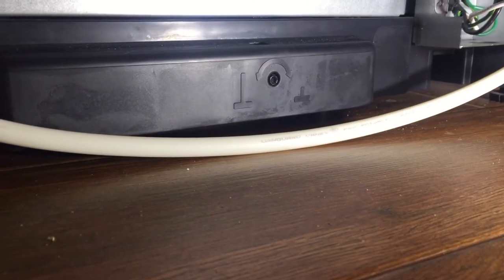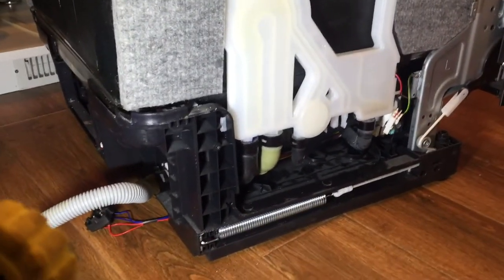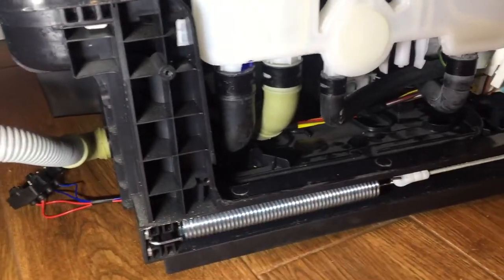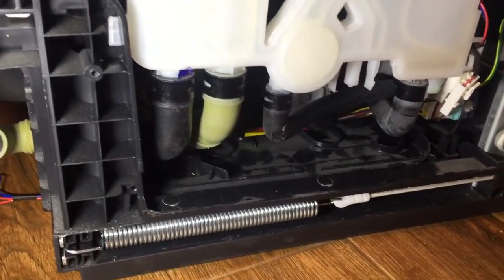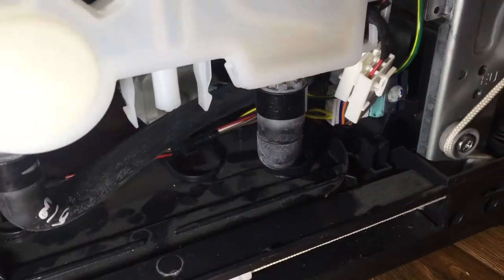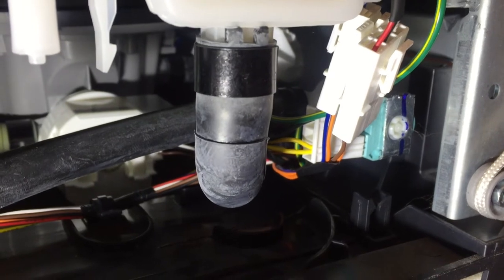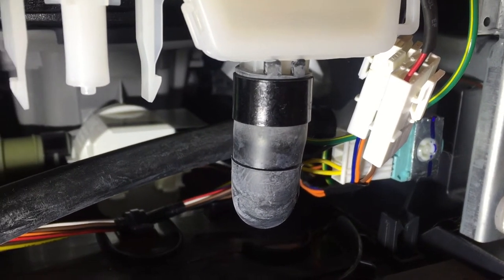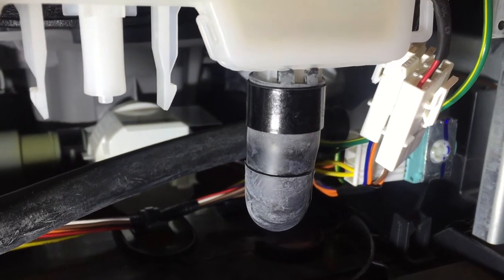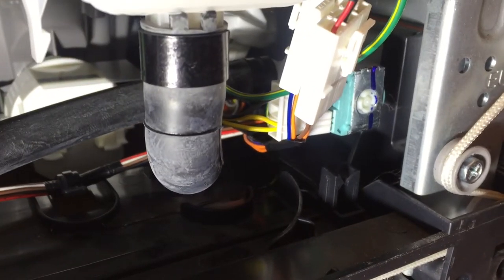That was looking good. I didn't put it on risers this time so I can't see under it, but the puddle is always so big it should be pretty obvious. While I've got it running through a cycle, I decided to take the side off so I have access to all of these hoses to check for leakage. Right underneath that inlet valve, there is a little puddle under it. I don't see the puddle growing — it almost looks like it's just from moving the machine around. I'll get a paper towel in there to dry it and see if it recurs.